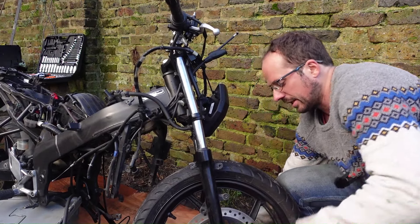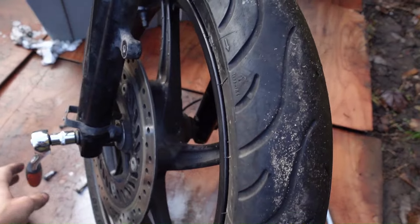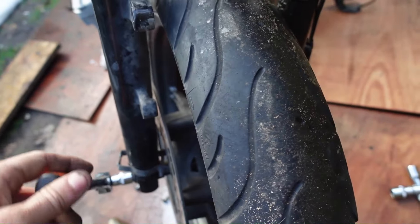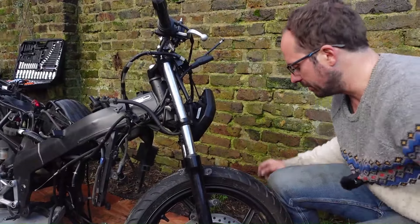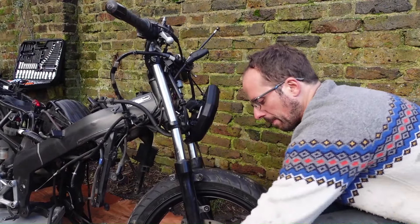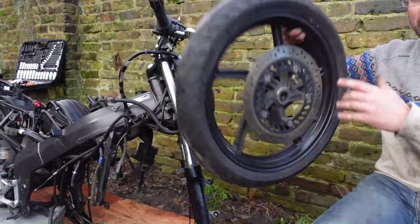Here's a good little test I'm going to show on camera. When you undo spindles it's always a great idea to keep the wheel steady and turn the spindle, because you can see that as I'm turning it the gap is opening and closing — that means the spindle is really bent, so this spindle is toast and we'll change it. One spindle out of the way, one front wheel out of the way.